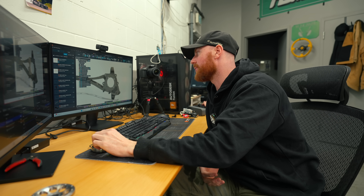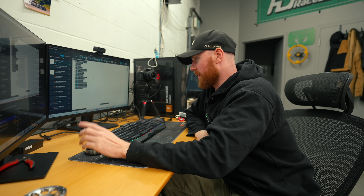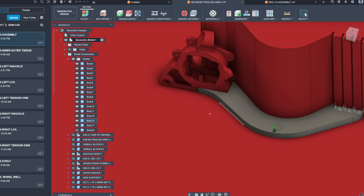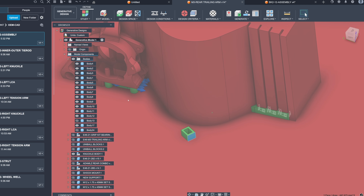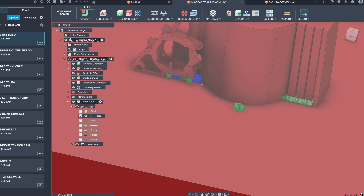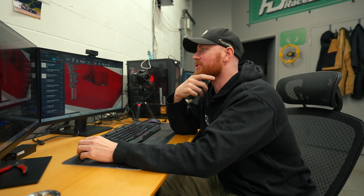This would be essentially really easy to change at the track if you messed up the wheel bearing. I have not come anywhere near finished this. I was also for many, many hours running some generative design work on the rear trailing arm portion only, and this is what it looks like when you have generative design going on. I can hide these bodies — essentially all the red stuff is avoidance regions, all the green stuff is what we need to connect, which is called preserved geometry, and the blue are the forces. I actually have a whole bunch of forces being applied to this thing.